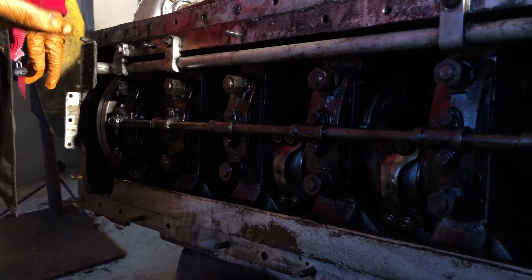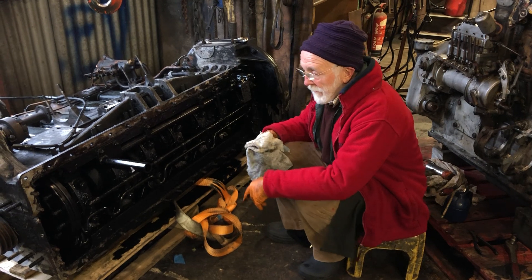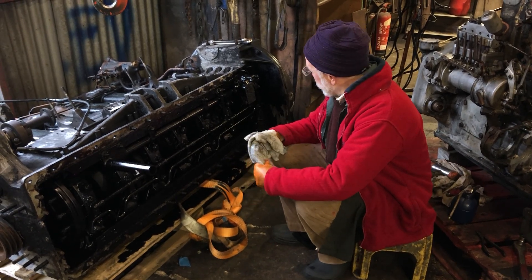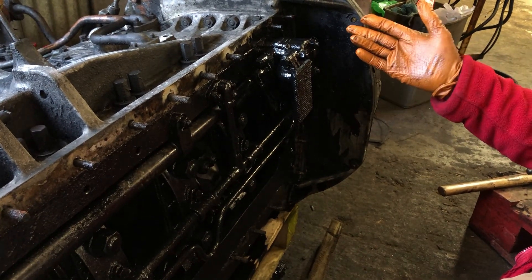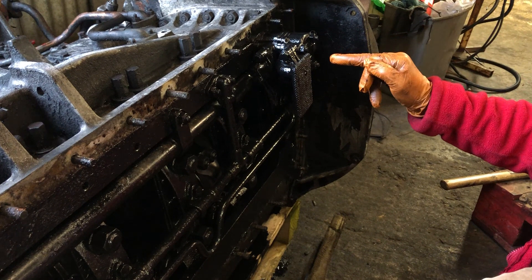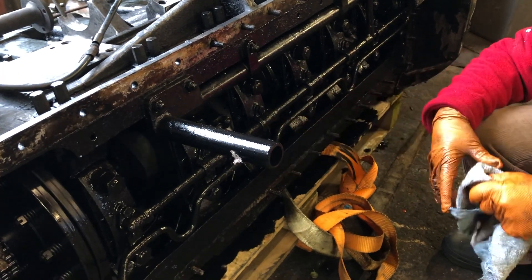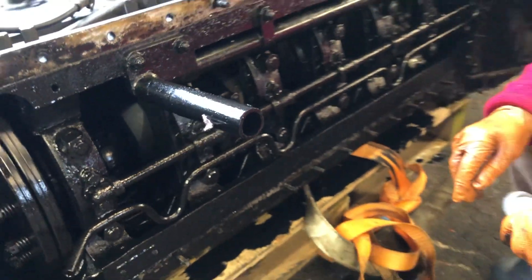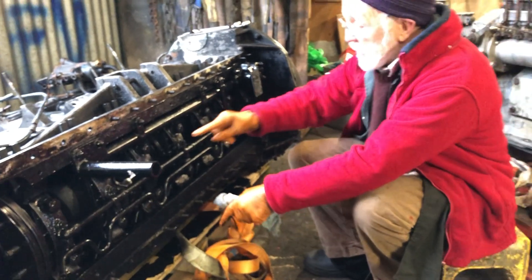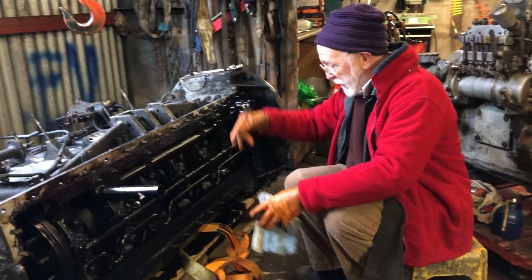So we'll go back now to the forward sump — we'll pop the sump off and I'll take you through the pipework there. We've taken the sump off back at this first engine again. The first thing you'll notice is this is the main feed pipe here. The oil pump has to be located here, it can't be anywhere else without a major redesign of the engine, so they were stuck with that. They had to put the oil pump there and they had to suck up this pipe here. Notice how thick the pipe is compared to the other one — the other one is about three quarters of the diameter of that one. So the main sump pan is here, and the pump sucks the main volume of oil up through this large pipe here, up through the crankcase and into the engine.